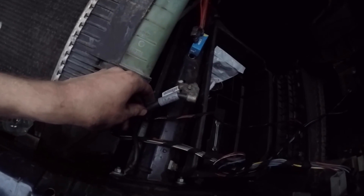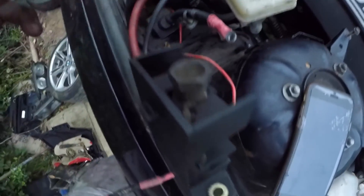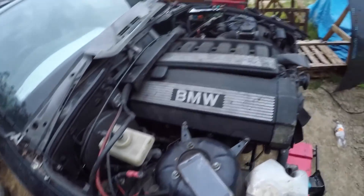Don't forget to bring the negative from the six cylinder car — I'll show you that as well. Once you've found your ground from your six cylinder, find an appropriate grounding spot. Ideally it would be there, but I haven't been able to get this tray out. There's the positives and there's the negatives — pretty simple. You've got a thick one and a thinner one, so they logically just go there and there. This top thing is if you need to jump start the car, and you've just got to find somewhere to secure this down. That is really the car wired.